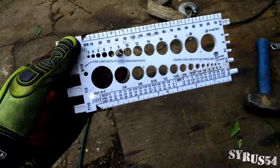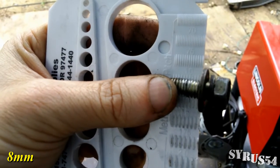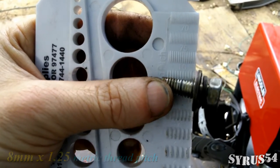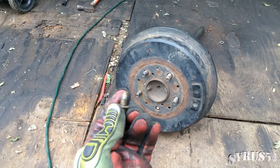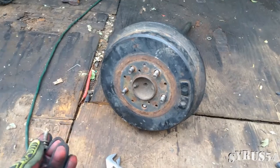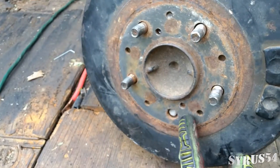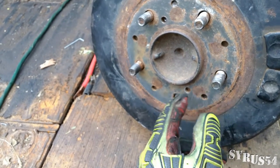The size of the bolt I'm going to be using is an 8-millimeter with a 1.25 thread pitch. I have not seen anybody else's YouTube video actually explain to you what size bolt to use — they just say go ahead and put a bolt in there because any will work. No, you need a specific one, because my brake drum is pretty much seized on, just caked on with rust and years of abuse.